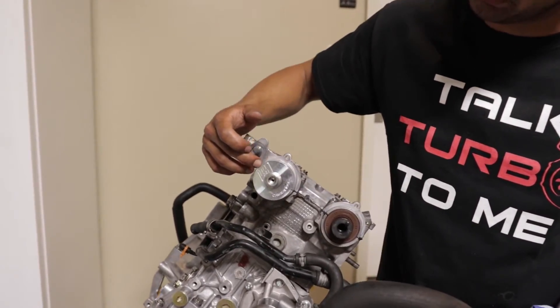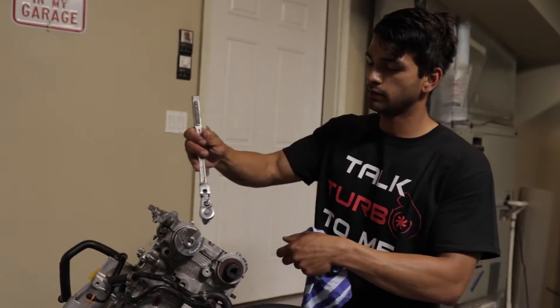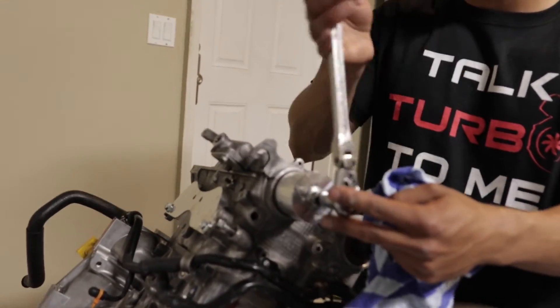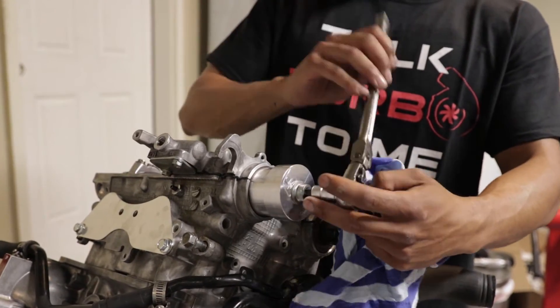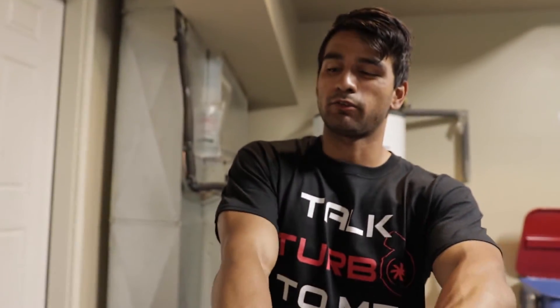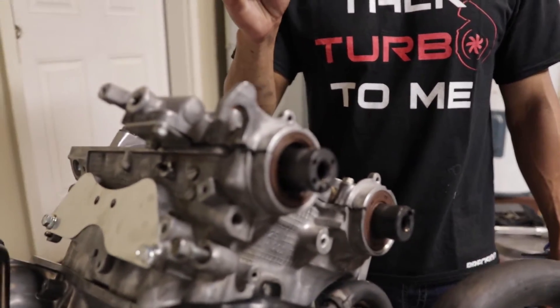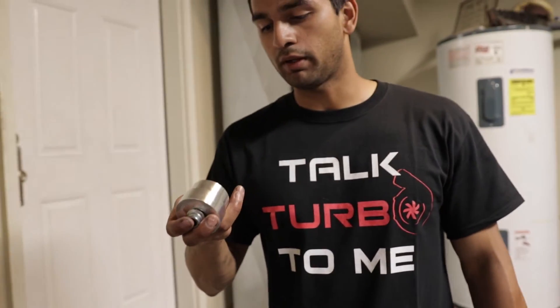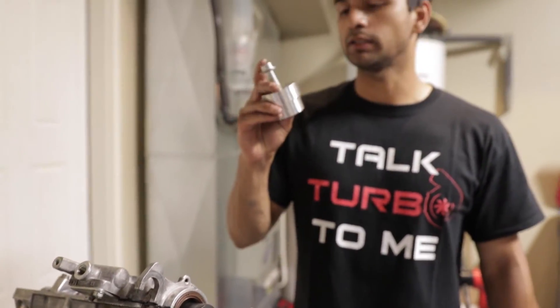I'm using a P&L cam seal tool. With this, it's supposed to make it a lot easier to install the cam seals. All you have to do is thread the supplied bolt through and the seal goes in effortlessly. I bought this simply because this is my third or fourth motor and we're barely halfway through the year — not including all the rebuilds in my car. I'll put a link in the description. It's not a lot of money but definitely well worth it. It gets the seal flat as a pancake, and that's what you want. It's not sponsored — I just like talking about good products.